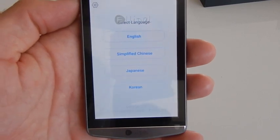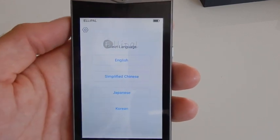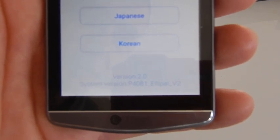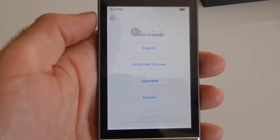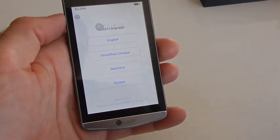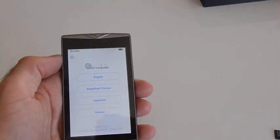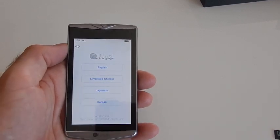First we need to check: if you want to use ADA Cardano coins and store Cardano on this branded wallet, it may be necessary to upgrade the system firmware. If you look at the bottom it says version 2.0, so we need to upgrade it to version 2.1 in order to store Cardano ADA. For that we will need an SD card formatted to FAT32 file system.